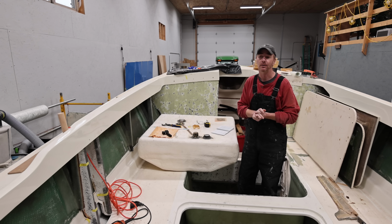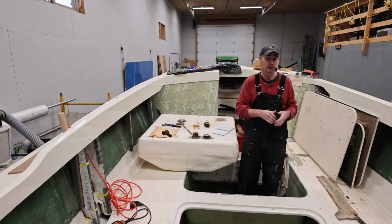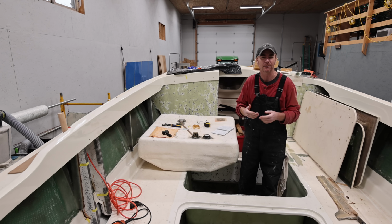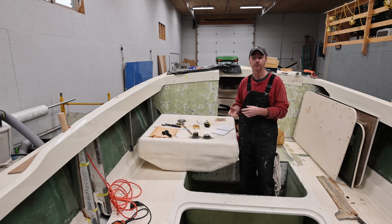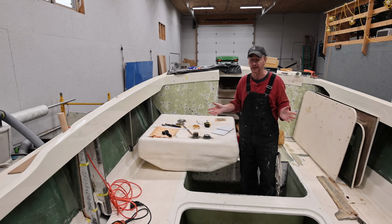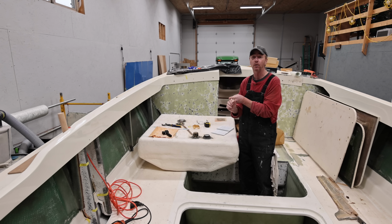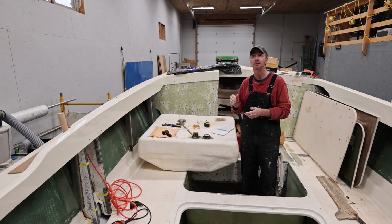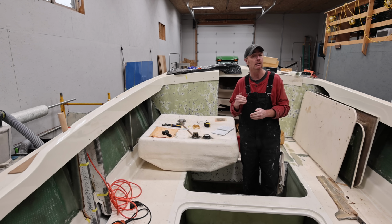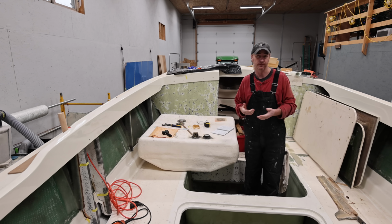You know, I don't know. I mean, the issue with the original tanks, way back when, is that they were built with polyester resin. I think I may have already touched on this, but the ethanol in today's fuel broke down that polyester resin and it created a whole host of problems. Now, supposedly this was built with either vinyl or epoxy. I'm not sure which one, but it was one of those two materials, which my understanding is it does hold up a lot better to ethanol, but I don't know that it makes it ethanol proof like some of the other options that are available out there.